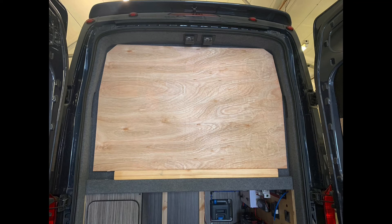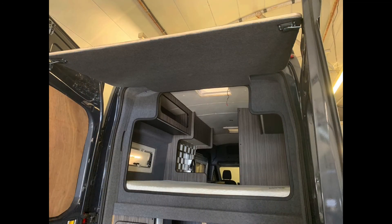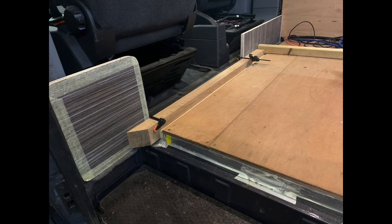That's pretty much the first cut out of that panel. The pictures are a bit in the wrong order - before you even put the motor up, I went on the inside of the van and just drew around the actual markings in there. Once I'd drawn around it I gave myself about two inches all the way around, made it all the way around, cut it out. Then I carpeted it, put some scrim foam on it, and put a big heavy duty rubber trim around it - the same as what's on the first inside bit.